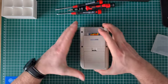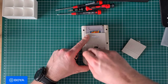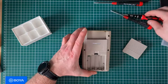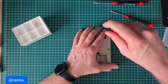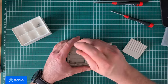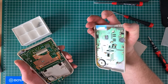Everything works, so we can clean it and have a good machine again. Let's remove the batteries and game and start disassembling it. To start, we have to remove the six tri-wing screws — the back screws are the same for all Game Boys until the Game Boy Color, I think. Once you've got all the screws out, you can remove the two halves from each other and then remove the ribbon cable from the slot.